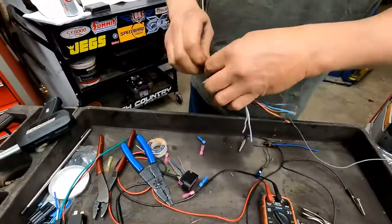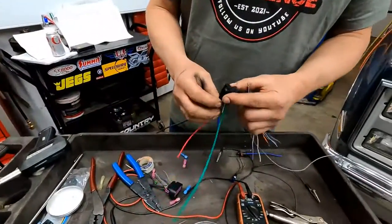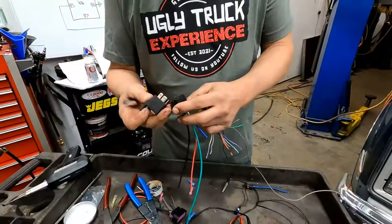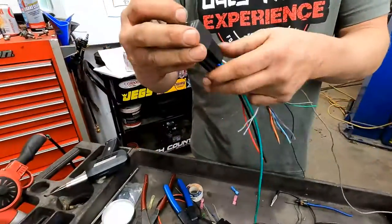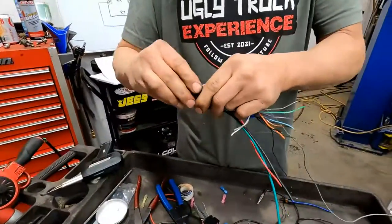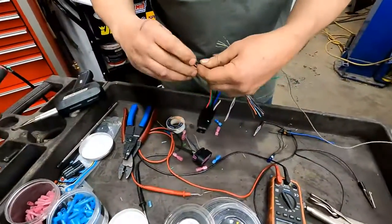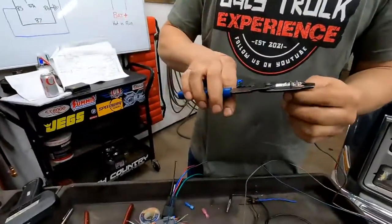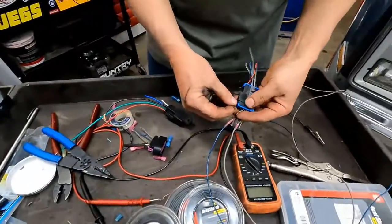Okay, so here we go. So pin 30 on our relay. I like using these also, because if somebody ever gets down there and unplugs it, it only goes together one way. So a person wouldn't have to figure out which lead goes on which one. So I like to use these, all right? So we don't really have a gray wire, but I'm using this brown one with a white strap. I think that's close enough. That'll work. Don't you? I guess I could do it.